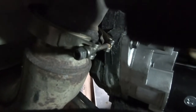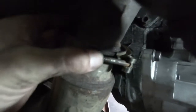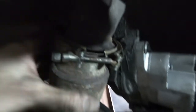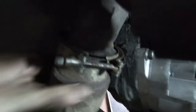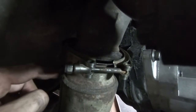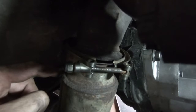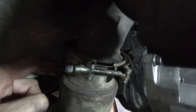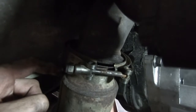Alright, tighten that up — it's a 12. Put the bolt on there, make sure they line up good, and the band clamp will hold them together. You'll definitely want to check for leaks there. This one is aftermarket — we have PPE upper and lower pipes, manifolds, and everything done to this one, which is really nice. Tightening that clamp down turns and just tightens everything together. If you're really struggling you could put a little jack under the pipe — not too much pressure, just enough to push it up and in.